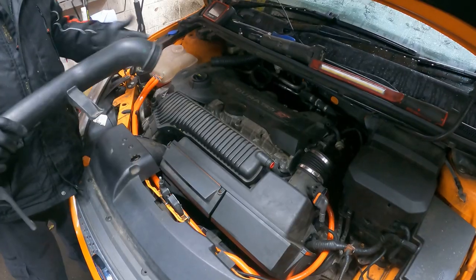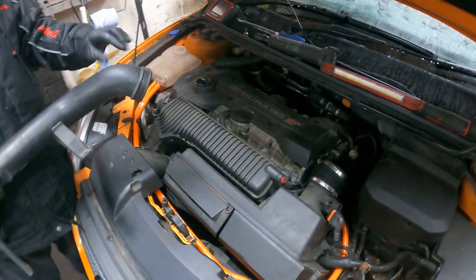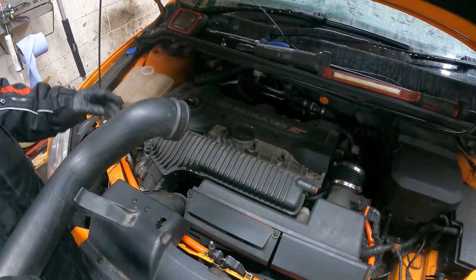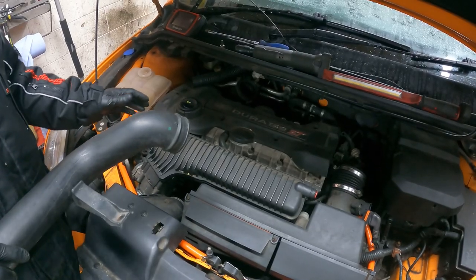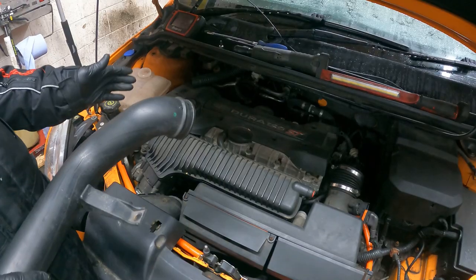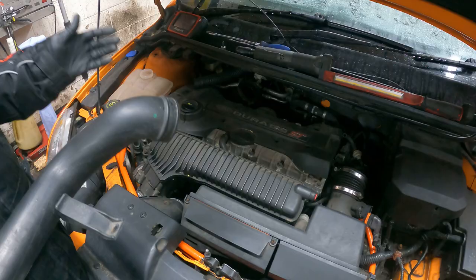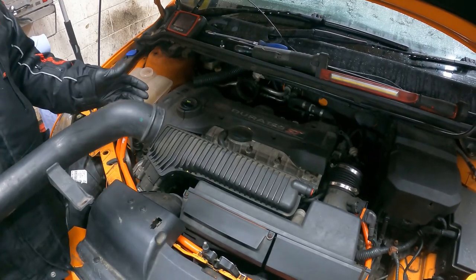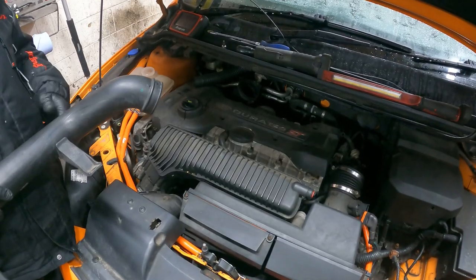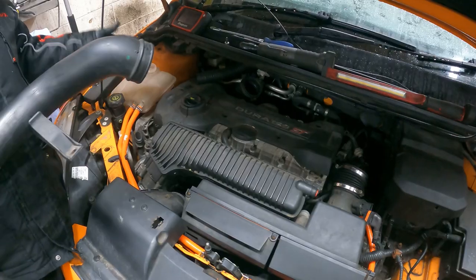It's not worth doing that if the engine has a crack in it. Our light inspection, making sure there's no cracks in there, doesn't give us a 100% guarantee that the engine is still good without pulling the cylinder off. Because of the way the engine is designed, we have gaps within the liners. There's still a good chance that those liners can be swollen, and if the gaps have closed up, unfortunately it's scrap.